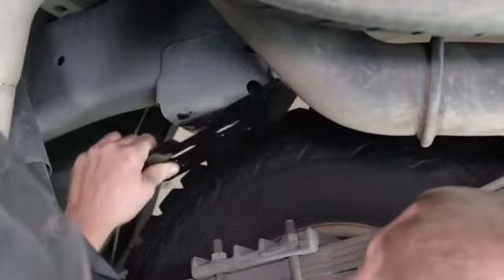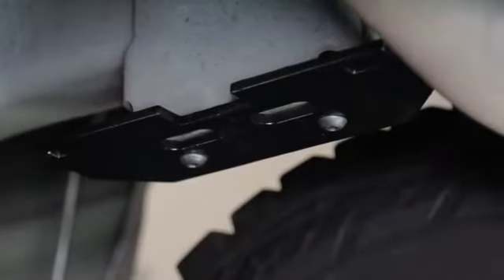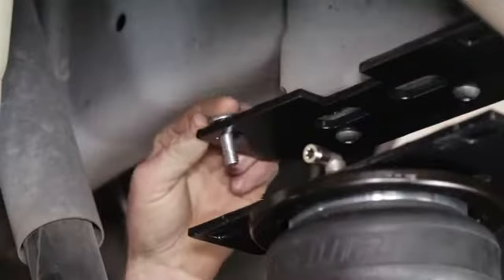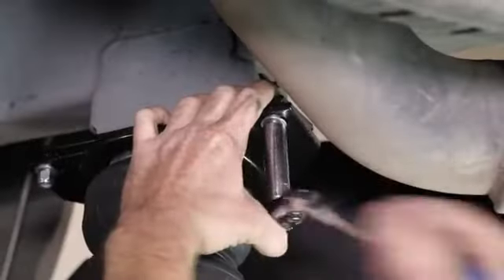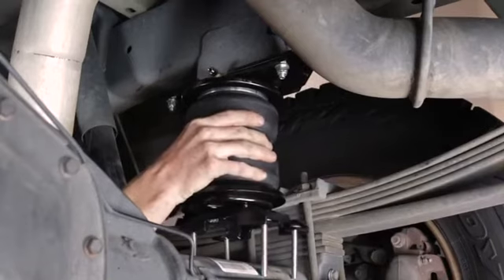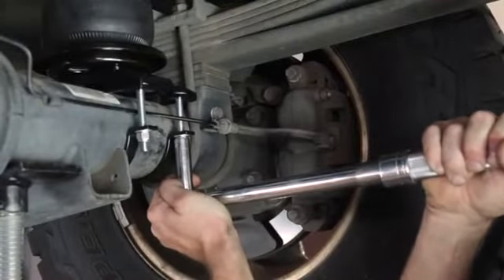To prep the frame for our air spring assembly, attach the frame upper brackets to the frame using the M10 screws and tighten securely. Now set the assembly onto the axle with the elbow fitting pointed inward towards the center of the truck. Align the slots in the frame upper bracket and cylinder upper bracket and secure them together with 3/8 inch carriage bolts, flat washers and nylock nuts. Adjust the air spring so the upper brackets and lower bracket are parallel. Secure the lower bracket to the axle using the axle straps, flat washers and nylock nuts.